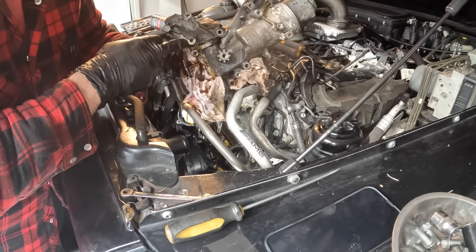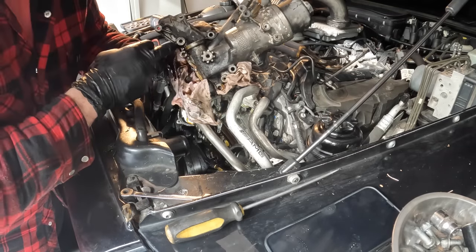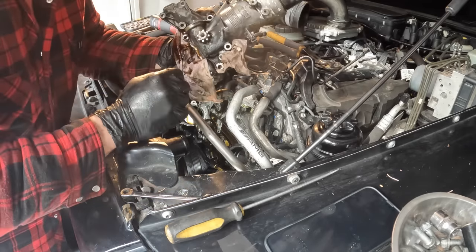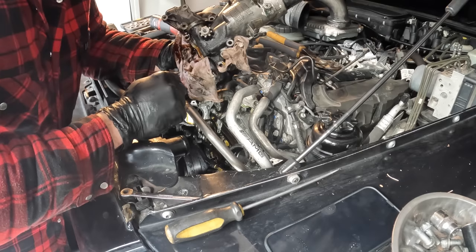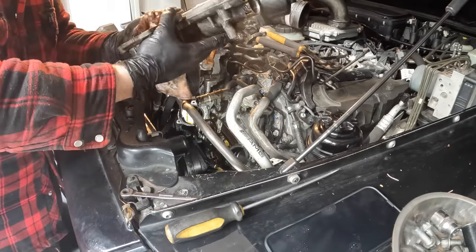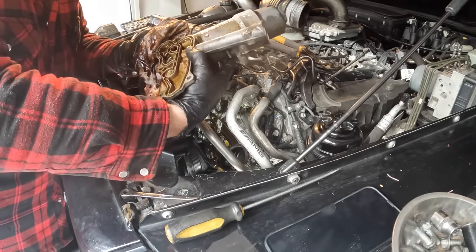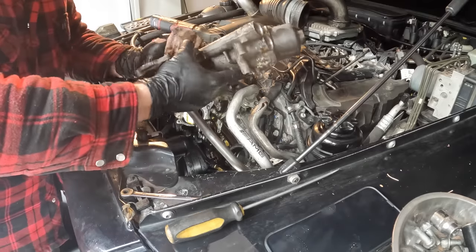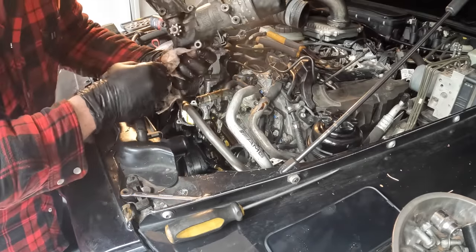So there is this plug right here that we need to transfer over. Looks like it's an Allen plug. The new one didn't come with this hole plugged off. So we'll transfer that over. And also might have to pull the oil filter out and put it in. I don't see a date stamp on this, so I don't know if this is original. It looks original, so